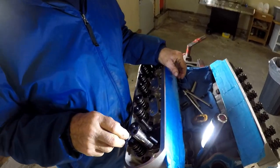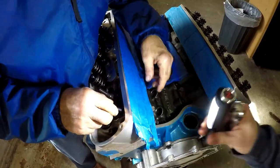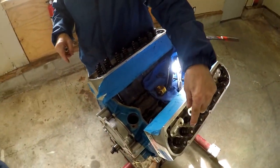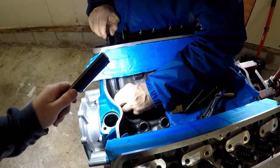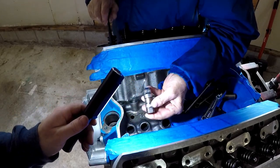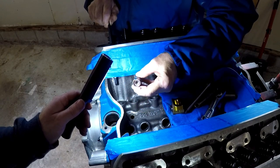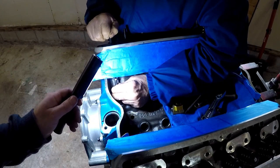All right, what we're doing now is we have a dummy lifter here. I don't know if you can see it — you've got to put the camera over there and shine it in here. Now you can see the dummy lifter, which is a Ford hydraulic roller. What you do is you take the spring clip out, which is that little wire clip in there. And you put a couple of washers underneath so that you can't push this in — so it's solid. The plunger doesn't go in. It's solid.